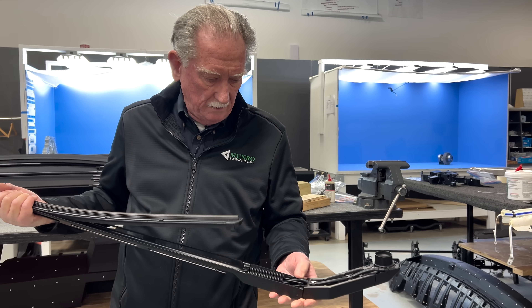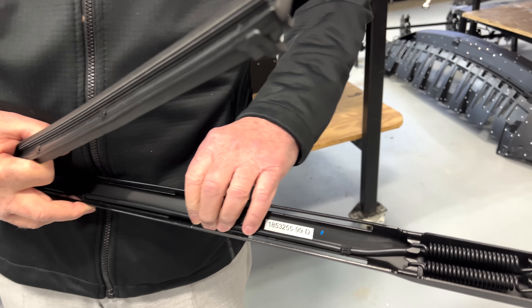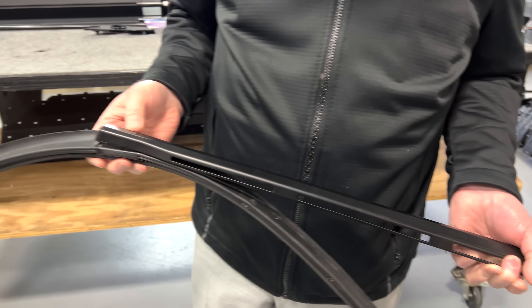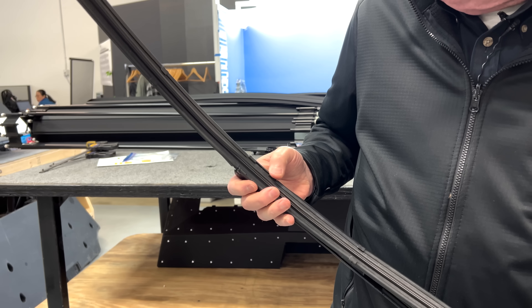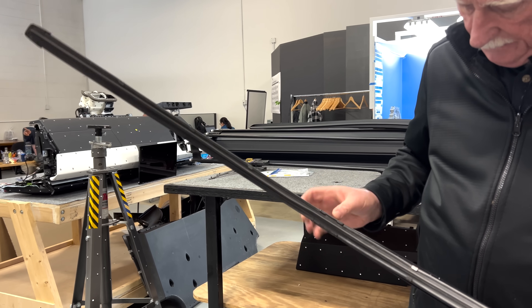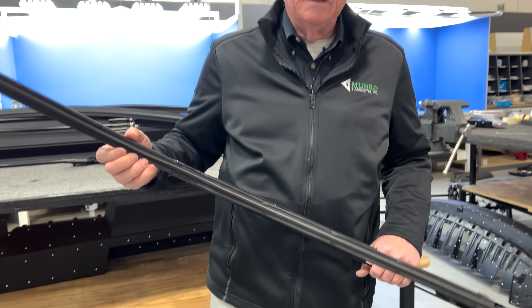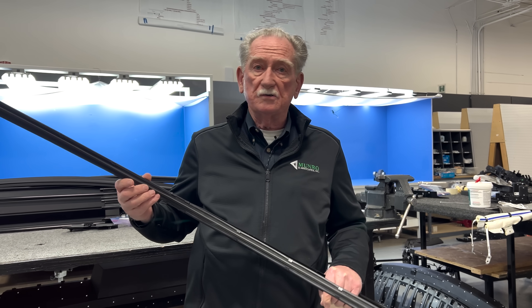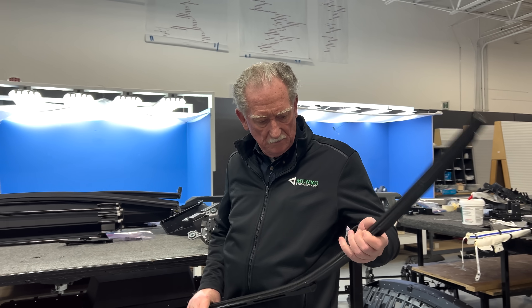What you've got coming up through it is the water system, so this connects onto a water bottle right here. The water goes down and you can see it going along the inside of the wiper arm. The track snaps in place and ultimately it goes to this central location, where the water is streamed out in both directions — it squirts down right through the blade and onto the windshield. That's what gives you your water for washing the windows.